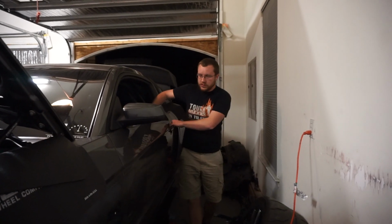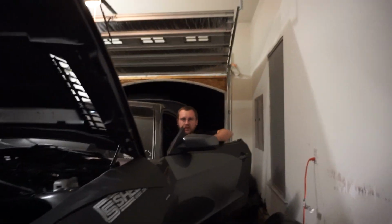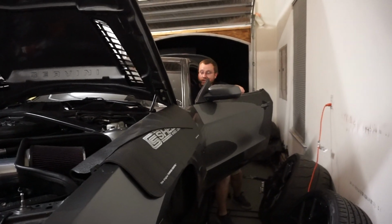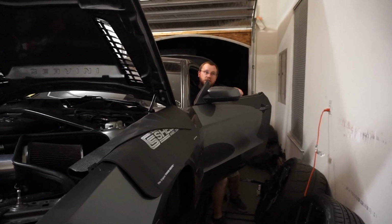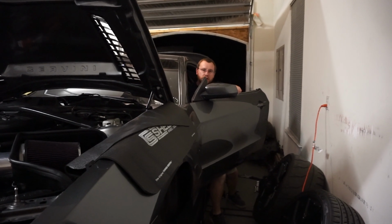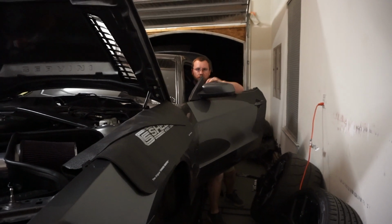I've already turned it over twice for a good ten seconds or so, and I'm gonna keep doing that a couple times to get everything nice and primed. And then I will plug the fuel pump system back together, and we'll probably get our first start, which is pretty nuts. I think the first time I start it, I'm supposed to let it get up to temp, because it would be bad for the motor if I don't. Oh, that just means it idles for a minute or a couple minutes.